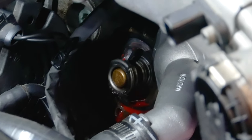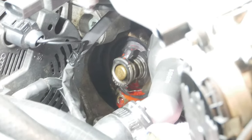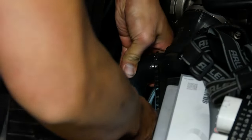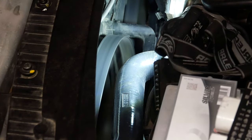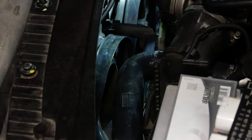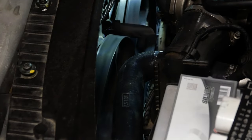I've actually installed the thermostat the complete wrong way around — the spring side shouldn't be facing this way. Here's a shot which boosts visibility. Once the thermostat is turned the other way around, I can reassemble everything. With the thermostat reinstalled properly, I can go back and warm up the engine, squeezing the hoses to ensure no air bubbles get trapped, and at the same time observing for any fan action. And this time you can see that they're working — finally! You can see that as the temperature is regulated the fans stop, and getting back up to temperature the fans start again. This means nothing was wrong with the electrics at all — it was all me putting the thermostat the wrong way around. Complete case of user error.